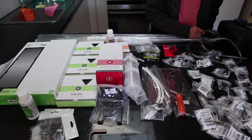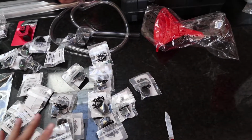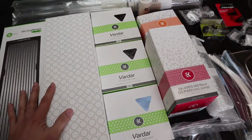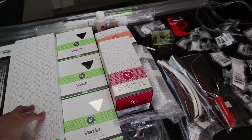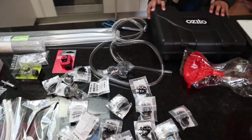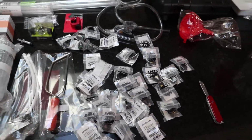All right, so this marks all the stuff that I had to buy. There was an EKWB 360 kit. This is his case. This is currently the 570X, I believe. Or oh no, sorry, this is the Define R6 already. Anyway, so Bitspower fittings. Those are the two rads. One is a slim type. The other is the standard 35mm. The slim is around 25-27mm. Flow control valves, fittings, and yeah, the bending kit from EK.